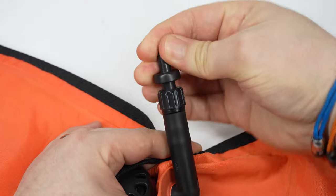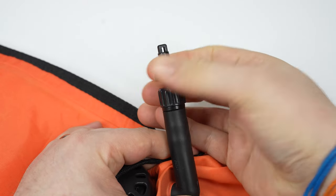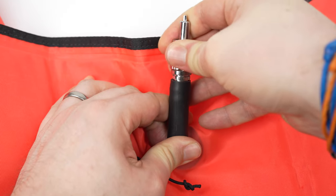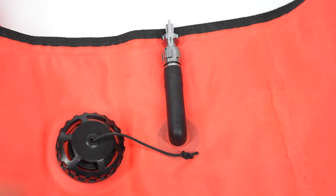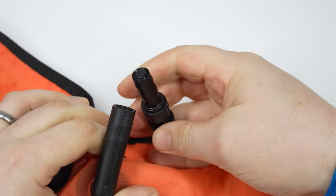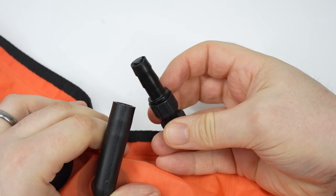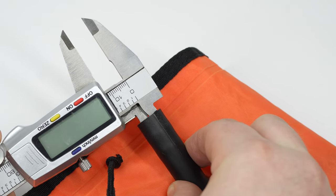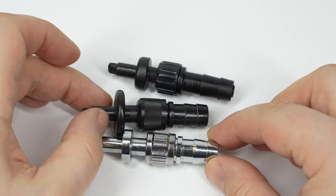The nozzle itself will rotate, but try to avoid that as it can damage the spring and the seal — it won't unscrew, you're just turning the spring. It's easiest to remove the entire valve; they're only pushed into a plastic tube, which will soften up if you warm it with a hair dryer or soak it in hot water. Plastic gets a bit more malleable, making it easier to rotate and pull the valve out from that short hose. The short hose typically has about a 12.5mm internal diameter.